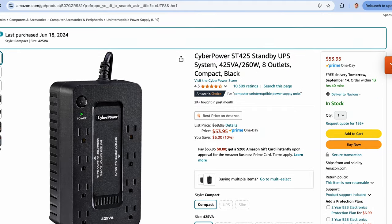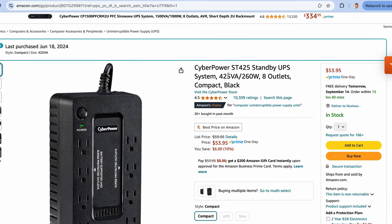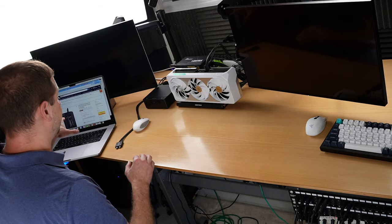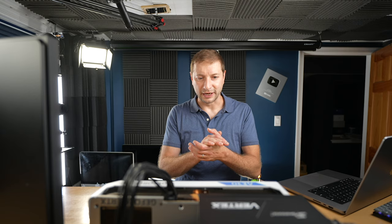We're talking about wattage here. I thought since CyberPower had nice support, I'd order another CyberPower. So I went with a tiny little one — just enough for protection: 425 VA, 260 Watts, eight outlets. The 1500 number on the old unit is actually VA — volt amperes — which is the apparent power rating. The second number, Watts, is what you really want to look at. In the case of the little one I just bought, it's 260 Watts. I thought I'd be good with that, since mini PCs take up maybe 50 to 70 Watts and these new machines are so energy efficient.